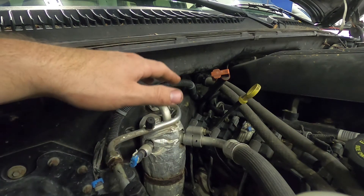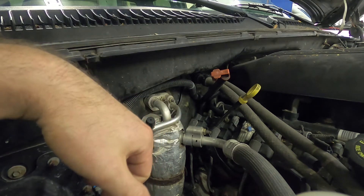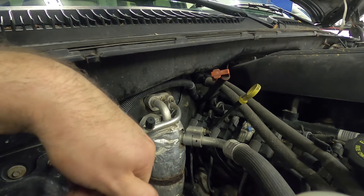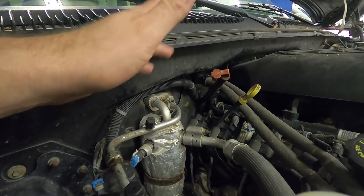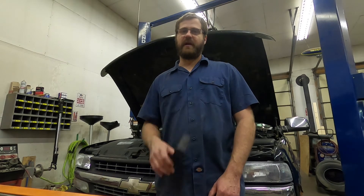I'm making this video while I'm waiting for spark plugs. I'll finish it up after I get them installed — I'm going to put one in to verify that it works, then I'll probably do the other seven as well. Now I've got the new spark plug in. I haven't touched the other seven yet, but I've got the number eight spark plug replaced. The misfire is gone, and that'll be it for this video. That's somewhat of an old-school technique — you can use an infrared thermometer to find a misfiring cylinder on pretty much anything with exposed individual exhaust runners.